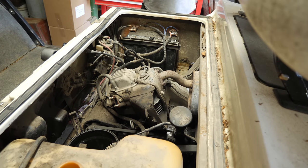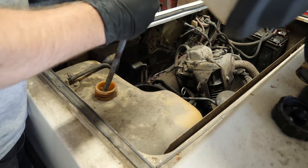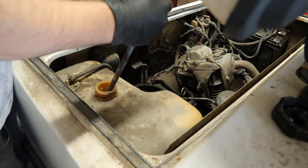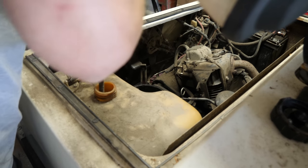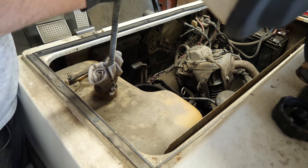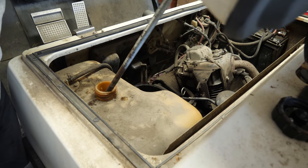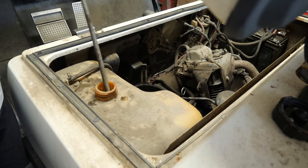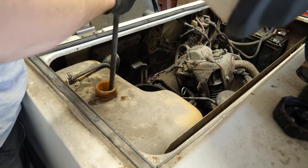That part's done. Now we get to wipe the inside of the tank out. You can see down in there — you know that crap on the bottom of the tank? The big thick black part in the center is the dip tube, but you can see how dirty that tank is. We're going to move our gas cap so we don't knock it behind the gas tank. This won't get all the debris out doing this, but it will get the majority of any moisture that's in there. You could also just leave the tank open to atmosphere as long as it's in a closed area — you don't want to leave it outside if it's going to rain. That would just defeat the purpose, and that usually will be enough to allow the tank to dry out on its own.